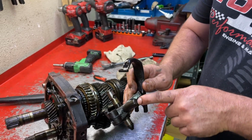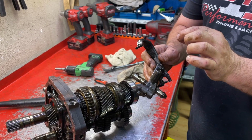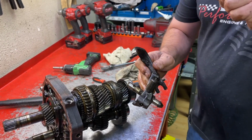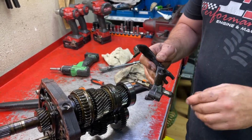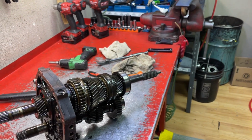Yeah, we fixed it one time by drilling a hole in here, and we stuck a piece of welding rod in there and just hit the gun real quick and grabbed that ball and pulled it back, then pulled the thing apart and pushed it through, cut it off, replaced the ball. We didn't have another one, and they're expensive. Oh, okay. Good to know.